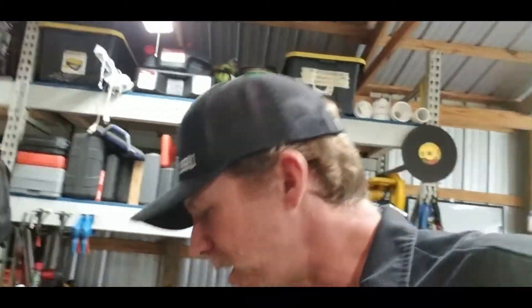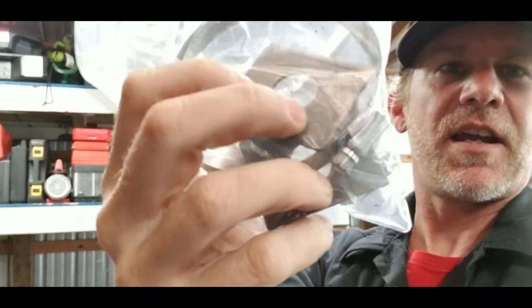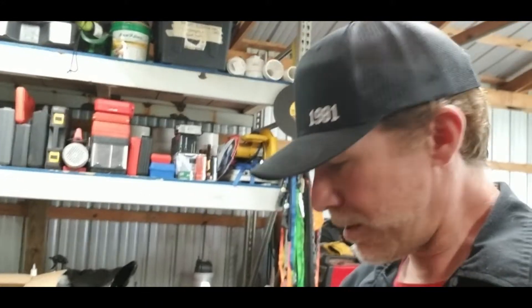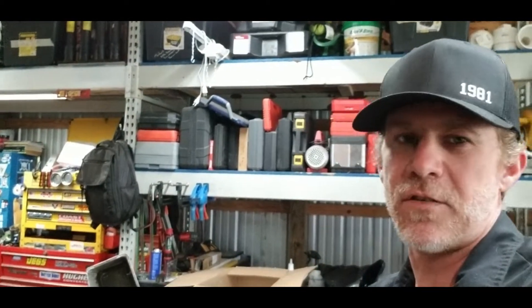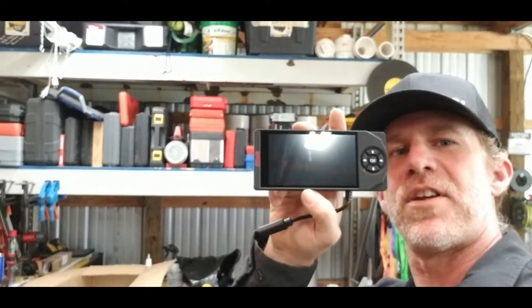O2 sensor — for those of you guys out there that don't weld, it comes with the clamps and gaskets. All you have to do is use a stepper bit, put a hole in your exhaust, use the hose clamps, and clamp it over the gasket. There's the computer — I believe it's all waterproof, but I've always liked to keep things inside the cab, so I'll be figuring out how to mount it there. This one's the display for this system. Pretty nice. I'm really excited to get that hooked up and see how it goes.